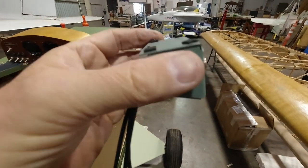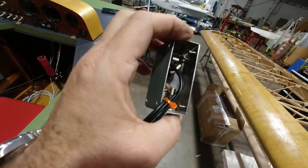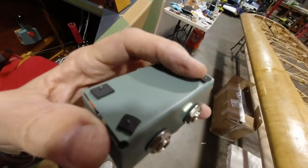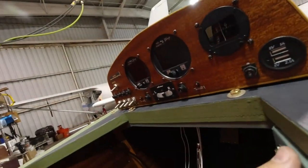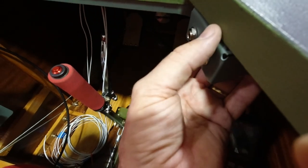I've checked everything out and it looks pretty good. I did sort of box myself in with where these screws are located. I do have the holes on the bottom to get to them, but I wasn't going to be able to get to them one at a time — it was going to be very fiddly. So what I did was take some foam and run a couple threads of each screw through the foam, and that's holding the screws in place while I get this positioned and get all the screws started. The cord location right here works out well because when it comes out here it just drops down in my lap and doesn't interfere with the radio in any way.